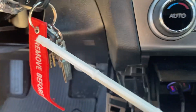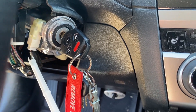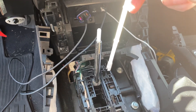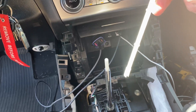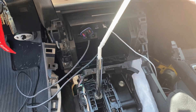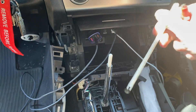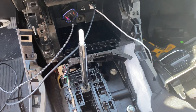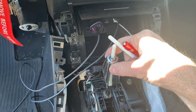I made a video where you can take this out and that will get your key out. But to get your key out that way is really unsafe, because it'll let your key come out while in drive. If you're in a stuck situation, you want to pull this knob off. There's a collar on there.